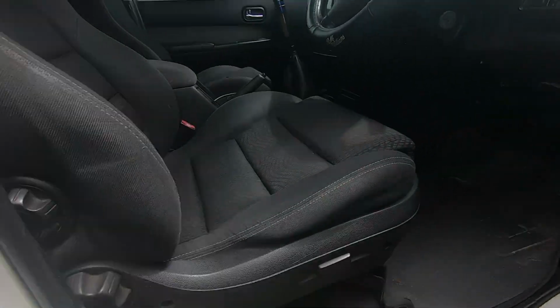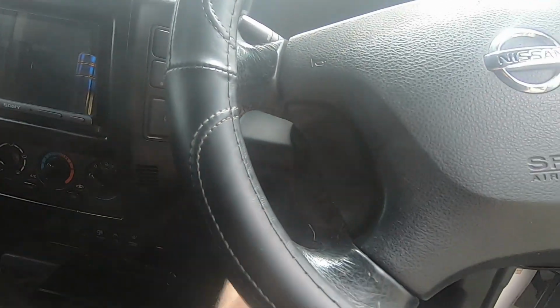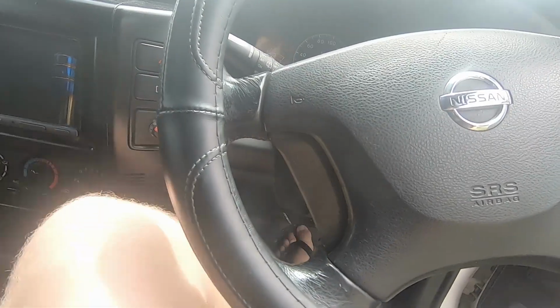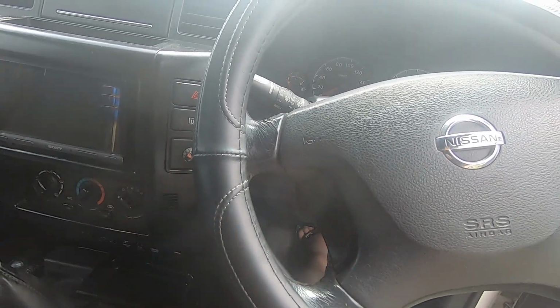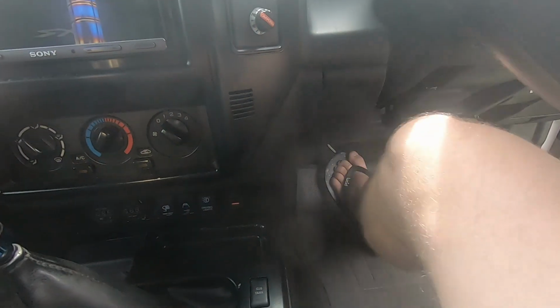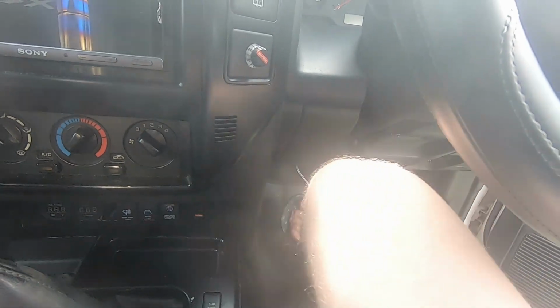Alrighty, so we've had that going, pumping the clutch, and also making sure our fluid is going down, which it did. I've topped it up. I've got a noticeably better pedal now, so when you first notice it, it'll be real shit. Still a bit spongy, but we'll get that last bit out down the track. That feels bloody way better than it did originally. That's good. So now that should hopefully fix our issue with the clutch pedal.